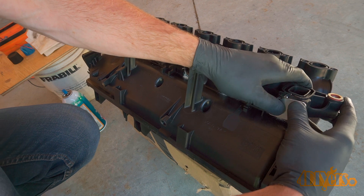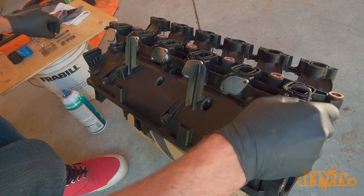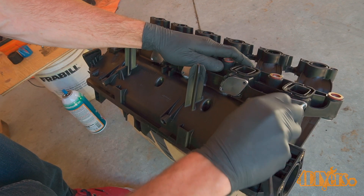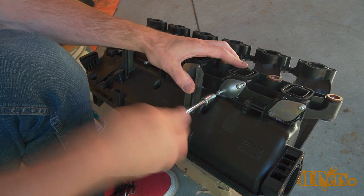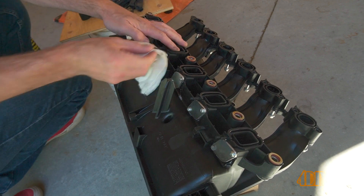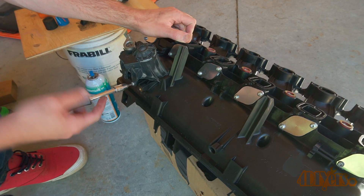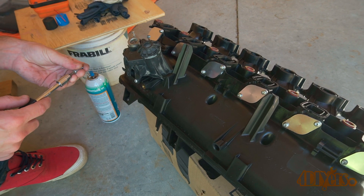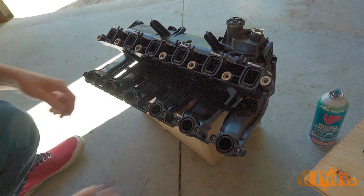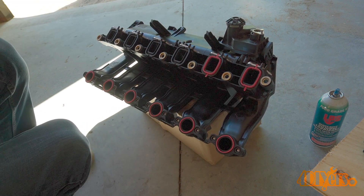Install the new swirl flap caps — these simply slide into place. After that, install all the fasteners using a T20; you can reuse your old fasteners. As mentioned, these caps are only intended for off-road use. Any remaining silicone spray is then cleaned off. The swirl flap actuator motor is reinstalled along with its fasteners. The grooves are cleaned for the intake gaskets and then new intake gaskets are installed — these were supplied by Turner Motorsport, and links will be in the video description. With every sale from using the links I do get a bit of cutback which helps keep my channel going.